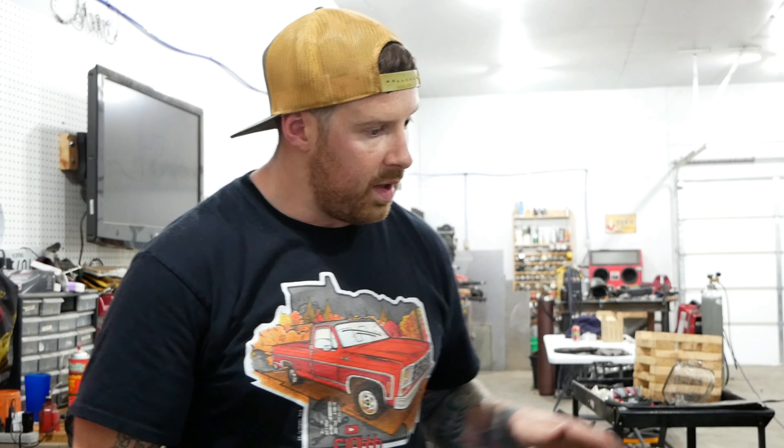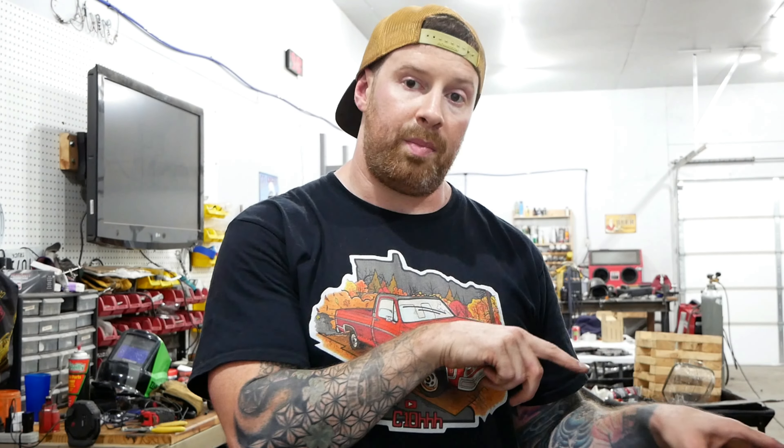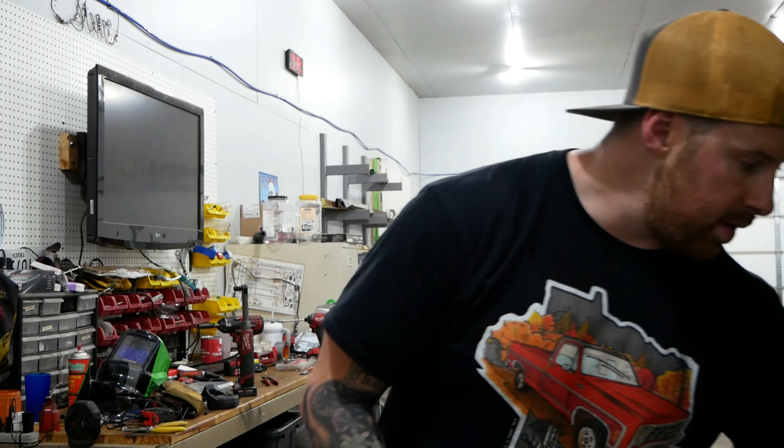I'm glad I checked that. The connection angle from the downpipe to the existing exhaust is way off. So I think I'm going to have to reverse my approach — put the car back up in the air, connect the downpipe to the rest of the exhaust underneath, and then break the tacks up here and see how things line up. I'll probably have to cut more of an angle on one of those pieces and finagle just a little bit more.